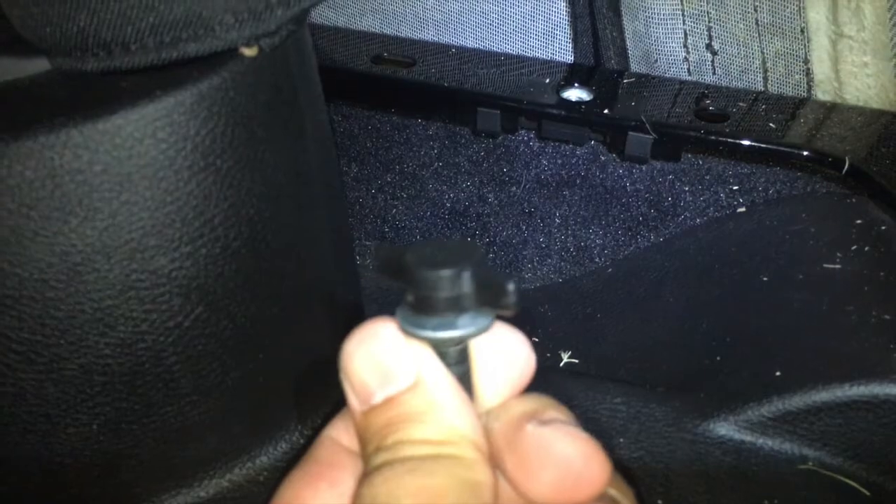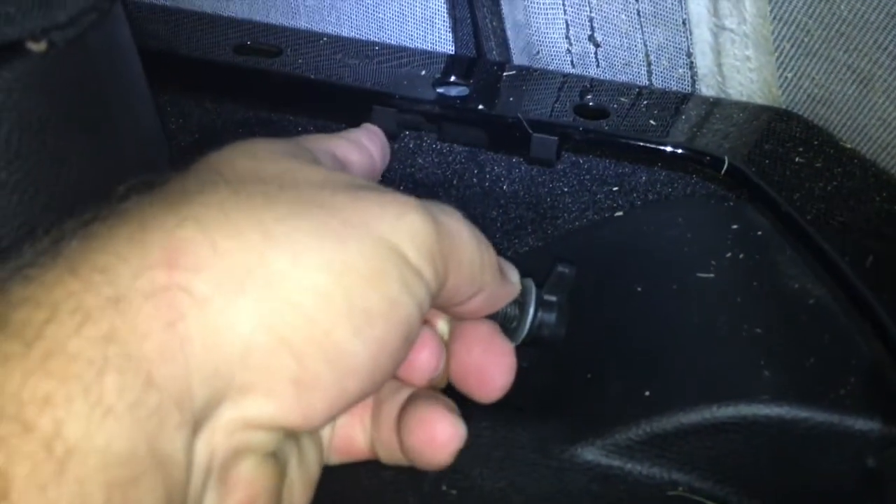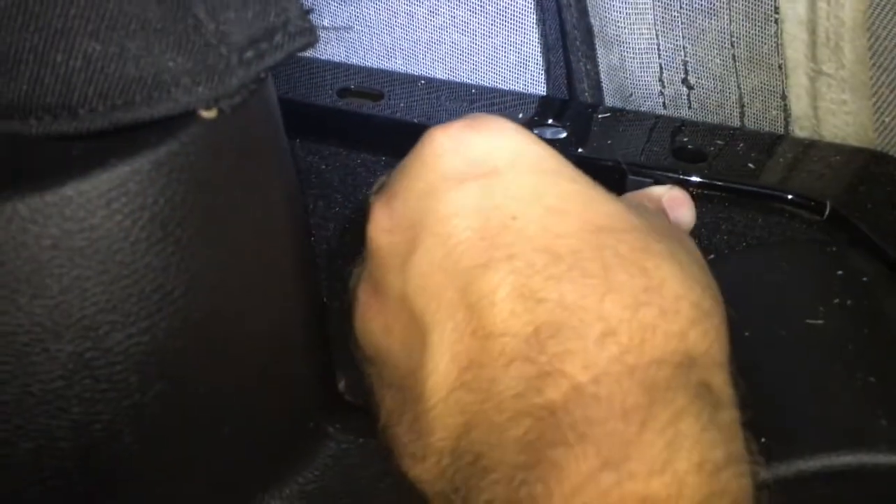Two more quick things. We're going to go ahead and put our thumb screws back in here so these blocks don't slide and move out of position or fall out. That's tip number one. The second tip — this Jeep did not have the straps. We tried to order some stuff off Amazon and didn't like anything, so we got these. I think they're 18 or 22 inch — they're folded in half right now. They're kind of like a rubber coated wire tie. We put them up here on this part of the frame when the top is down — loop one end around the frame and the other end around the rest of the top to keep it in position. Just that last little tidbit, and that's it. Thanks.